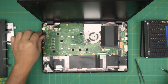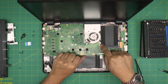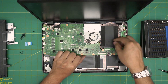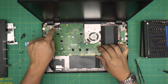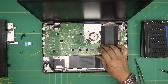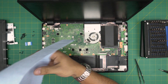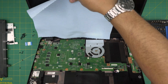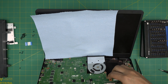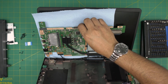Once you remove the three motherboard screws, the motherboard won't just come out on its own. There's a tiny hook right here — lift this hook on this side, then lift up. Don't remove the flex cable for the LCD; leave it as is. Grab a workshop towel, put it on the screen so you don't scratch it with the motherboard, then scoop the motherboard back and lay it over there.